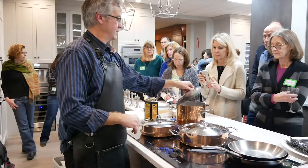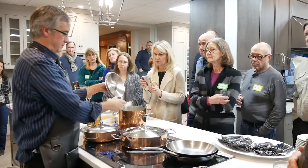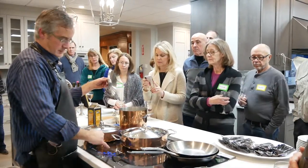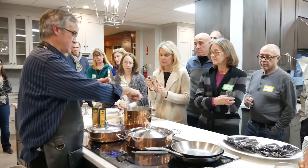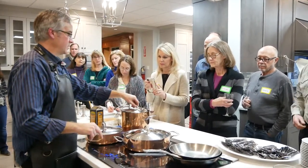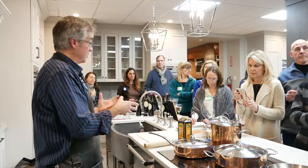With induction on setting one, we don't see the water roll into a boil. On a regular radiant top it would roll to a boil, shut off, then 25-30 seconds later do it again. With induction, it just runs constant — let's say at 10% of its wattage. On a 2,000-watt burner, it's running about 200 watts on that low temperature. You're keeping soup and sauce warm without constantly stirring or worrying about burning.